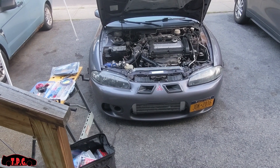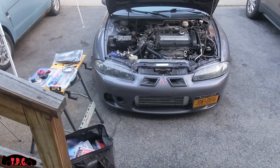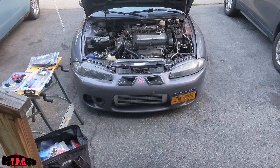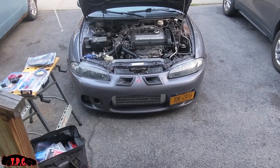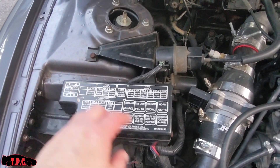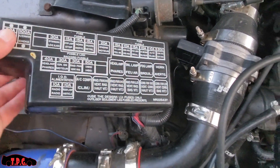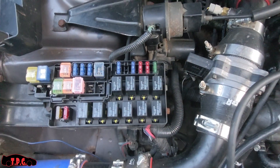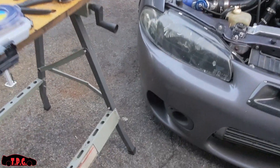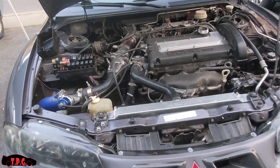What's going on driveway gang, welcome back to the channel. Today we're out here in our beautiful driveway at basically dusk, 86 degrees. I was out driving the Eclipse and we sprung up another leak - basically driving around with the fans on, we are blowing the fan fuse, this 20 amp fuse right here. We're going to try to mitigate this today. It keeps popping and it's driving me nuts because I keep getting stuck in stop-and-go traffic every day, and we don't want to overheat. So today we're going to fix this popping fuse on these Spal fans we've installed.